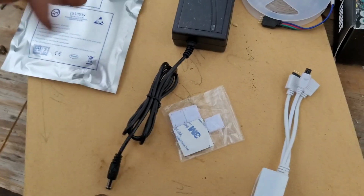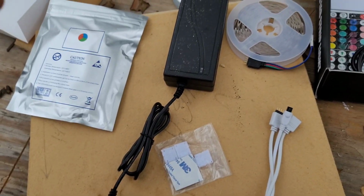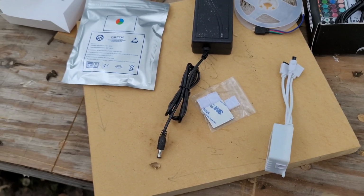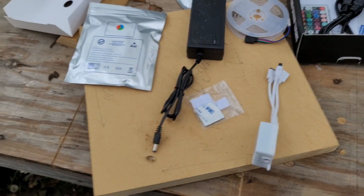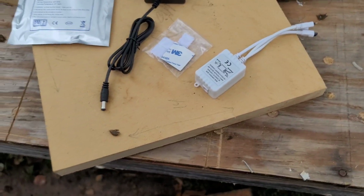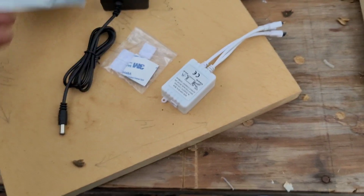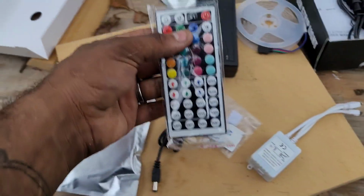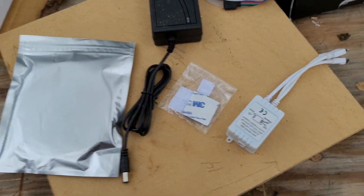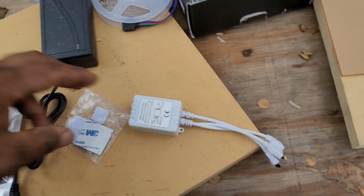So you could connect this a few different ways. You could connect your lights to your amp, so every time you cut your amp on, the lights come on. You could run its own power source, put a relay or an inline fuse just in case, and have a toggle switch put on it, or just use the remote to turn the lights on and off. But I think the toggle switch would be better because it's going to be in your trunk or whatever kind of vehicle you got.